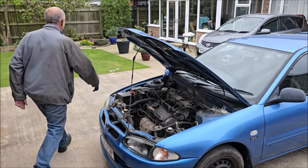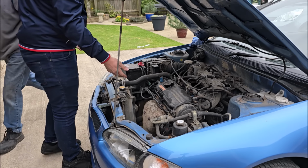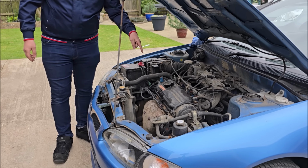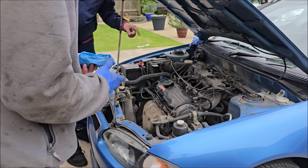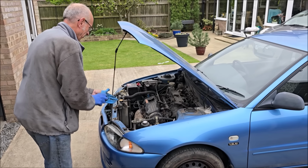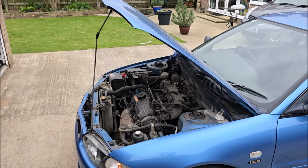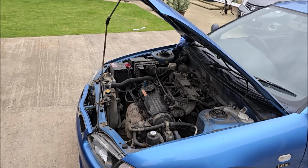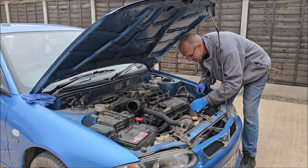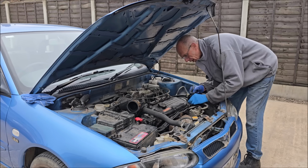Valve clearances, John. So valve clearances mean taking this rocker cover off, which is leaking anyway, so it doesn't matter. And obviously the engine isn't running right. These have got adjustable valve clearances. Which means you can adjust them. You take a spanner to it and some feeler gauges, and look in the workshop manual to see what the valve clearances are, and adjust them accordingly. Could that be causing the low compression? Yeah. I still think it's the pistons. Oh dear. But I'm hoping I'm wrong.